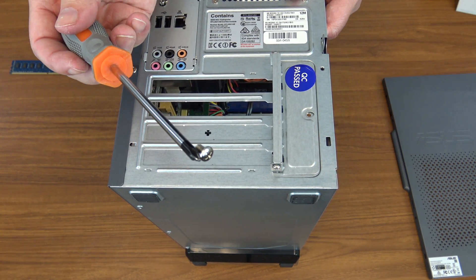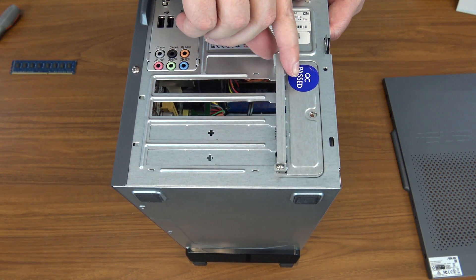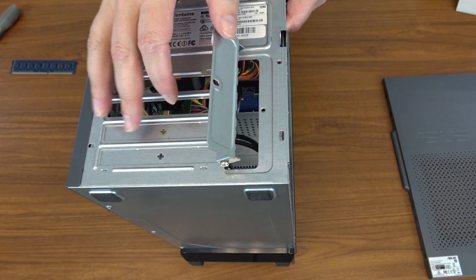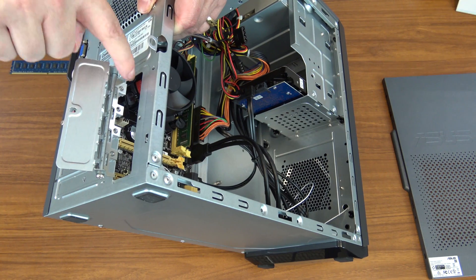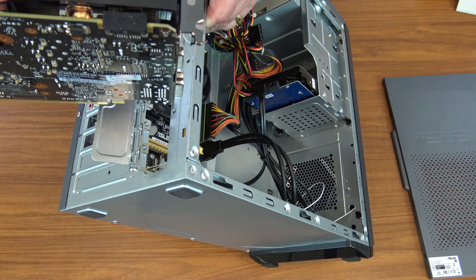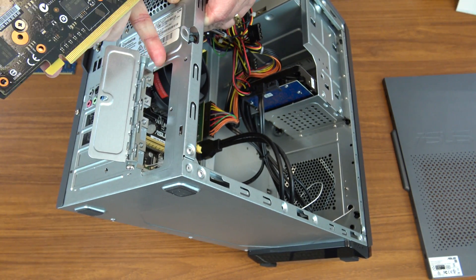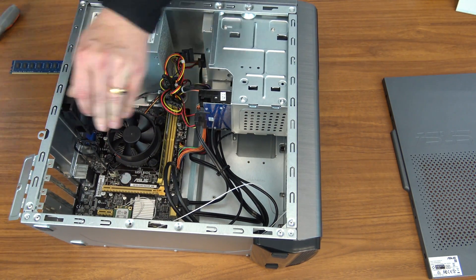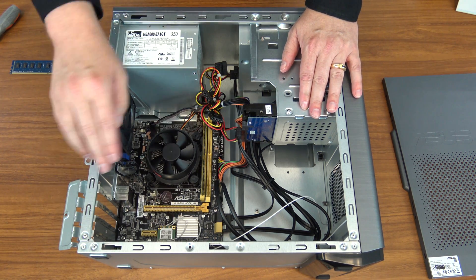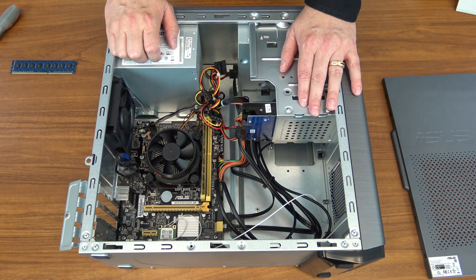It's handy to have a magnetic screwdriver, by the way — you don't have to have one, but it's handy. This opens that easily. The reason why we open it is this: the video card is going to rest on this shelf right here. If I hold the video card up, you will see that piece of silver metal right there on the end — that's going to rest right there on that shelf. Now that this flap is open and now that we've made sure that our top two spaces are open, we can install our video card.